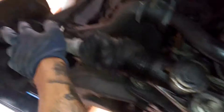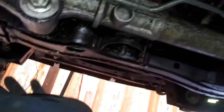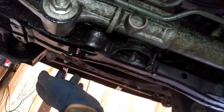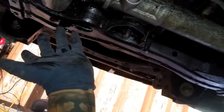There's a second and a third bolt right here, but you have to go up on top to access it — that third one is a 19mm. The tie rods are going to be 19s. We've got to pop out the cotter pins for those, and the same thing for that side too. There should be a little skid plate right here, held on by about four or six 12mm bolts.